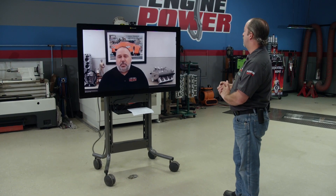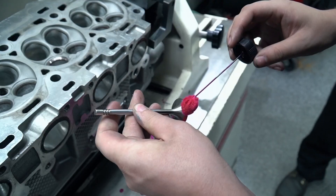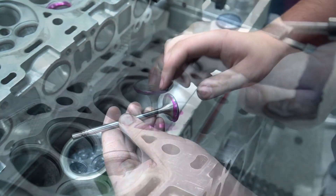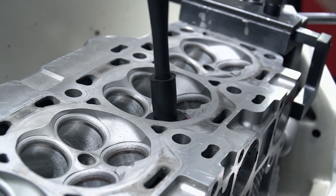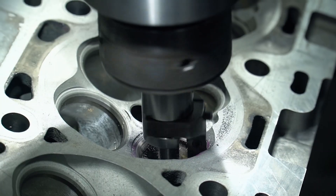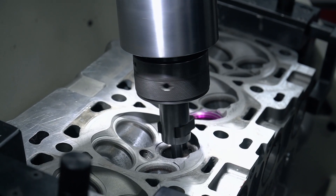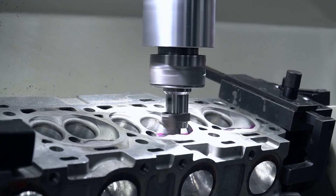Tell me a little bit about the valve job process. In any situation, we're going to want to start with any guide work because everything is centered off of that. As far as valve job angles, there's nothing that's universal — they are unique to the application and unique to the cylinder head. Depending on the process and the way the valve sits in the chamber, that top cut can have a lot to do with the lead-in. We're going to run with a pretty standard 45-degree angle seat cut, and the width of that seat cut has a lot to do with the valve job also.